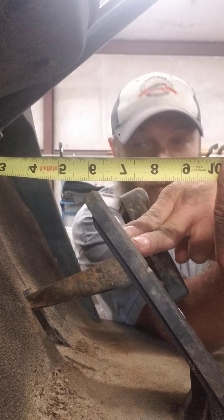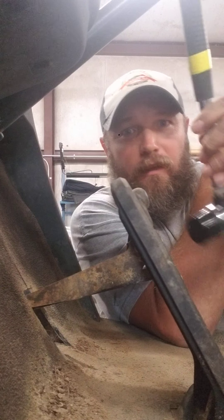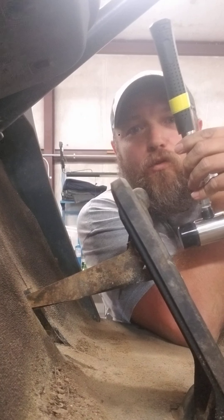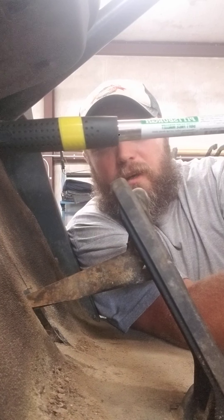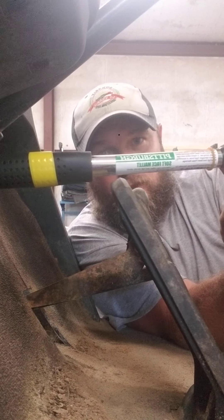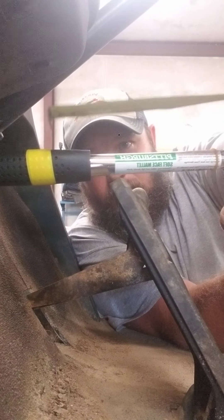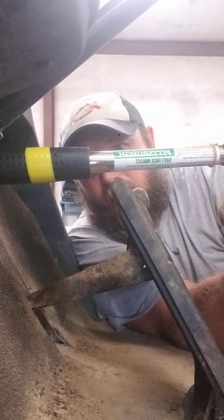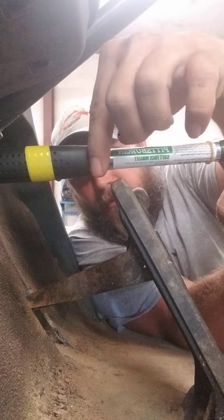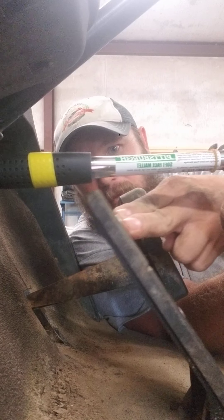If you don't have a tape measure or don't have time to buy one, you can make a mark on a stick. I've got my hammer right here — one of the hammers you guys may have. You can use a screwdriver, you can use literally a stick off a tree. Anything rigid works. Just go to any golf cart, push the pedal to the floorboard in the brakes' relaxed state, measure about two inches off of there and make a mark. You can also measure one inch off and put another piece of tape. Then when you throw this up there quickly, all you have to do is make sure your pedal is tightening up in between that area, and you're good.